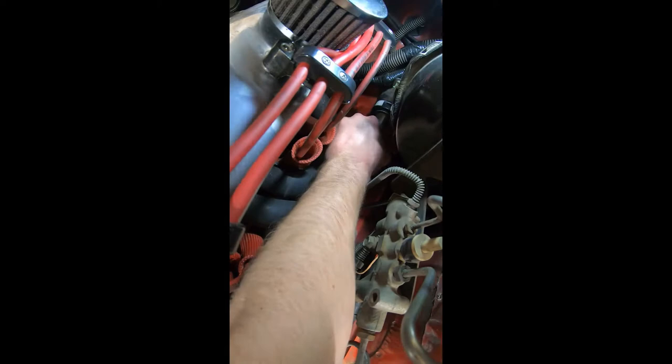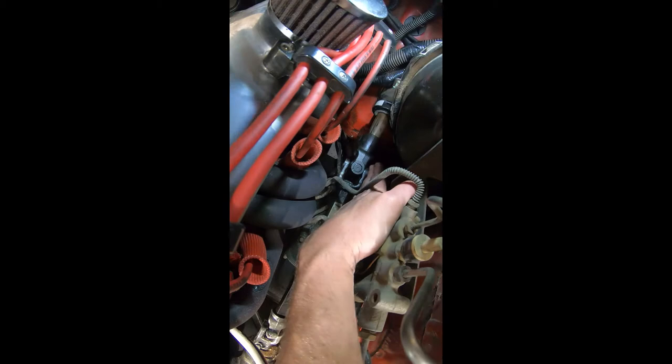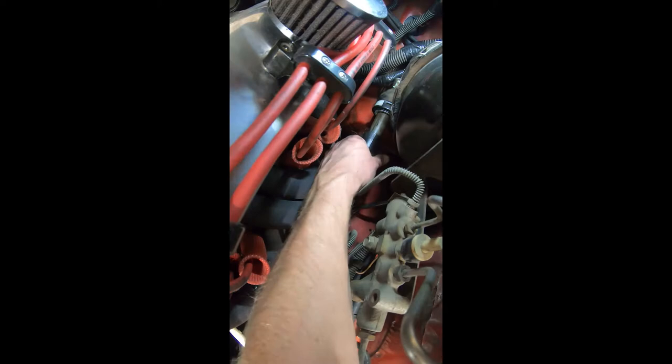As you guys can see, my bolt wants to come in from this side, which then, if I would do that, I would have to grind on the bottom of the shaft. So I think what I'm gonna do is mark it, and then turn the wheel so I can grind it on the top side here so I have access. Otherwise, that'd be way too hard to grind on the bottom.